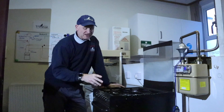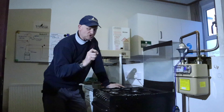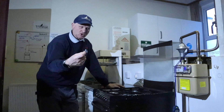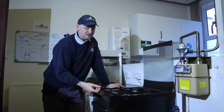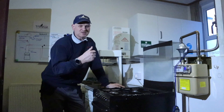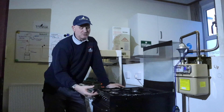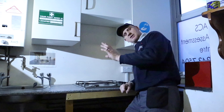A stiff gas tap normally happens when the seals have gone on the oven door, which sends heat up to the gas tap and dries out the grease within it, or can actually melt the knob itself. If you go to a cooker and the knob is melted or incredibly stiff, that's an at-risk situation, because it might get to a point where it won't turn off — and then that would be ID. So check the seal around the oven door for escaping heat.